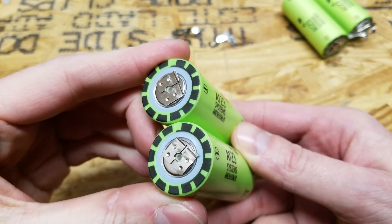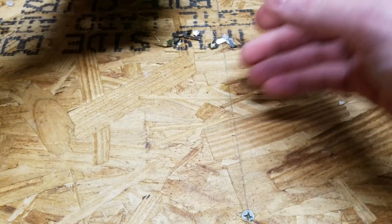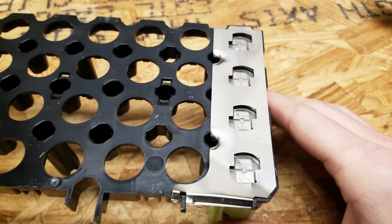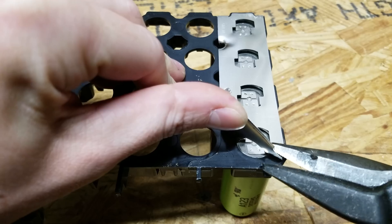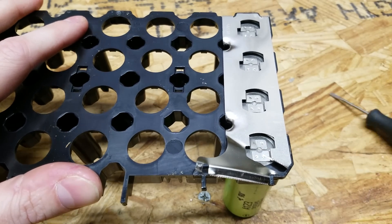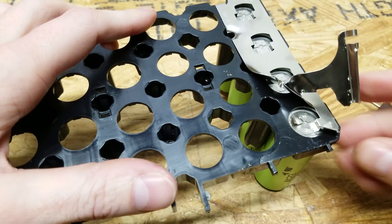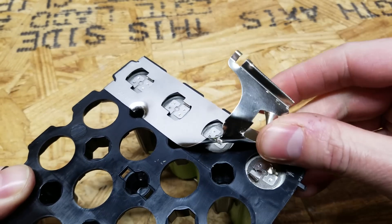These cells look great. I'm not used to working with 26650s — almost all my cells are 18650s. I'm not going to do all 48 on camera. We still need to talk about removing cells from the two ends of the pack, which have the heavier bus bar attached. The only way is to carefully pick apart the nickel using the tin snips, because sticking a screwdriver in would puncture the cells. As soon as you see it start to peel up from the cell, that's when you stop and slowly work your way up.